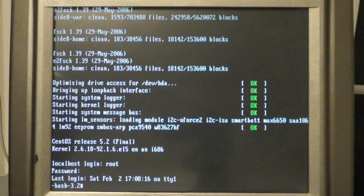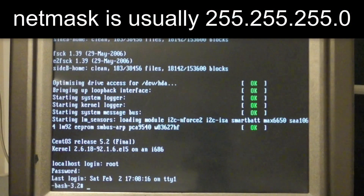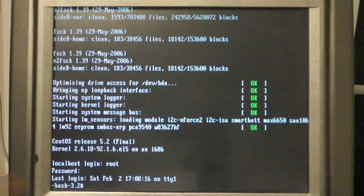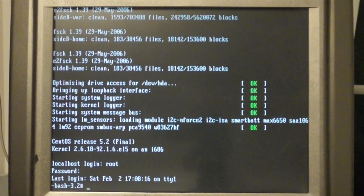You have to know what's called the network address and the netmask. The netmask is usually 255.255.255.0, but it could be different. So what I'm going to do here is set this up. What you need to do is give it an IP address — an address that's not used on your network. So I'm going to use 192.168.1.190, because I know that's not used.